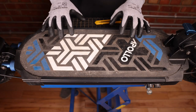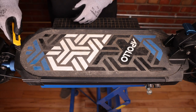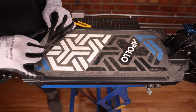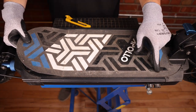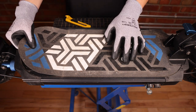The first step in the process will be to remove the grip tape. We're going to take an X-Acto knife and gently lift our grip tape off of the deck and then pull it away gently to not rip the grip tape. As this grip tape has some holes in it we'll be changing it, but as much as possible we want to keep the same grip tapes on the scooters for as long as possible.